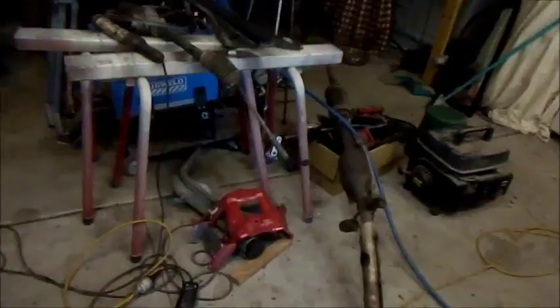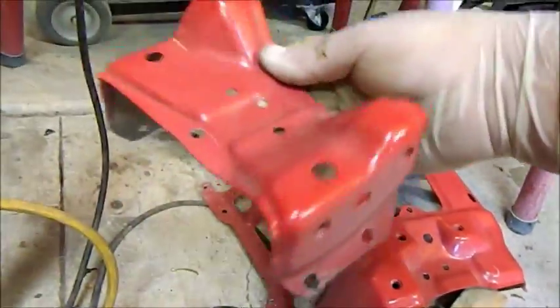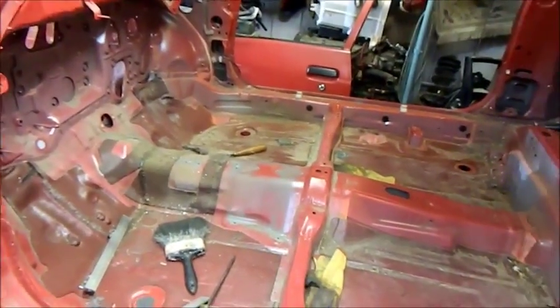The other thing I've taken off, of course, is the gear shift mount, if you like, and this front console mount. These are different on the 98 car. They're mounted there on the tunnel because that's where the airbag module mounts and all that sort of stuff. We're going to retrofit that with seatbelt pretensioners and airbags and all sorts of stuff.